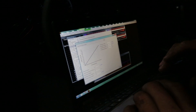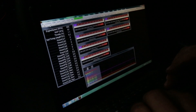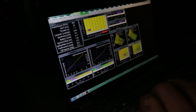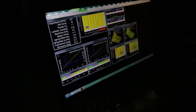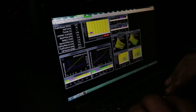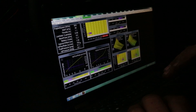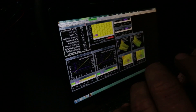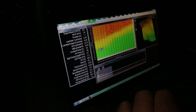What that means is that at any given point in time — there's our fuel pressure right now — our injectors flow at different pressures. Most ECUs don't have a correlation to that, so you're basically working on data cells of pre-determined pressure versus RPM. This gives us an additional factor. Right now we're at 36 PSI fuel pressure, and our actual injector flow rate right now is 780 cc's per minute. So we know exactly how much fuel is entering the motor. Therefore this VE number — volumetric efficiency — is how well the cylinder filling happens. Assuming all the other numbers are precise, we're filling the cylinder about 58% efficiency right now with a closed throttle.